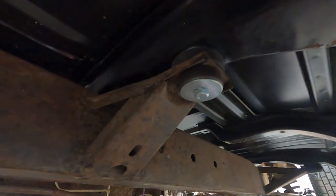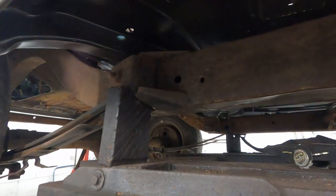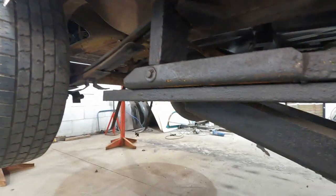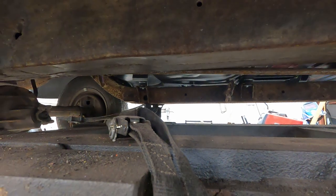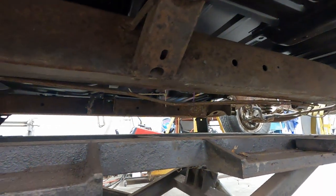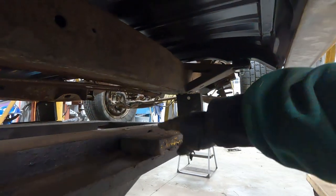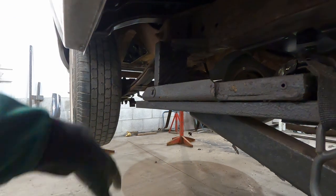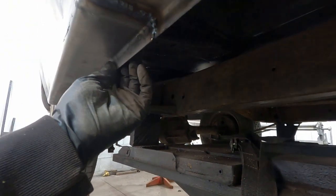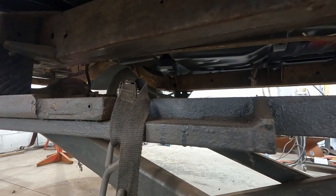For those of you that don't know, that's what a body mount looks like. This is my new one-piece floor attached to the frame. There's a bunch of these things — some up there, some back there, some over the wheel well area, some on the inside. I have to take all those off, put them in a box, and save them for a month or two from now. Then I'll position the scissor jack to pick up off some of these braces so I can get at everything I need, which is really just above the rear axle, plus some work on the inside of these rocker lips.